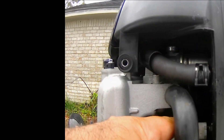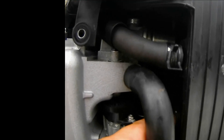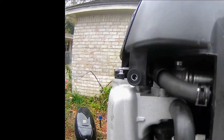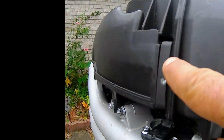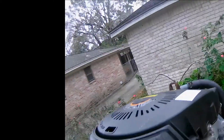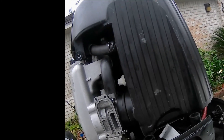Hindsight — I could have just pushed the IAT in like that, and it would have solved the problem, but I would not have been able to clean anything or inspect anything over here. So, once you're done, make sure this seal is correct — there's no air leak. Make sure this seal is okay, and it was rather easy. Now, over here, make sure this thing is on top. Once that goes in, all of this falls apart. I did have to take the bottom bolt out to be able to put everything back in, and that sums it up.